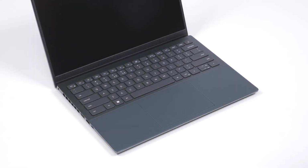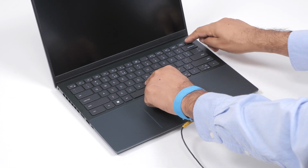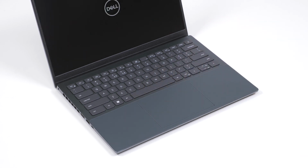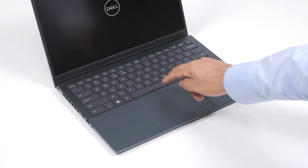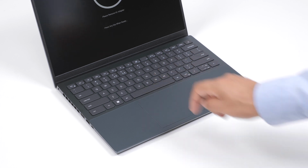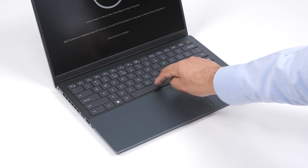To enter service mode, press and hold the B key on the keyboard, and then press the power button. Now, the computer will boot up and the owner tag information is displayed on the screen. Press any key to proceed. The computer will emit 3 short beeps and shut down.